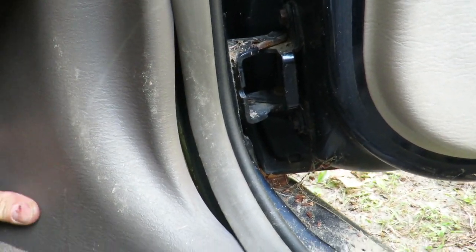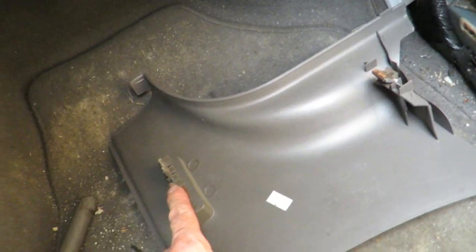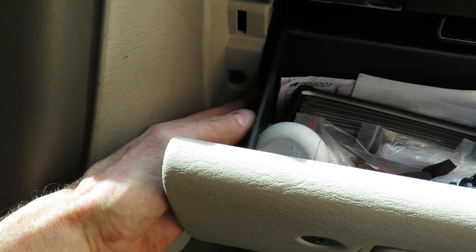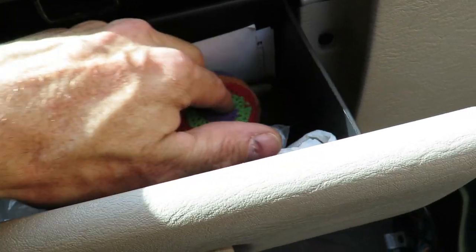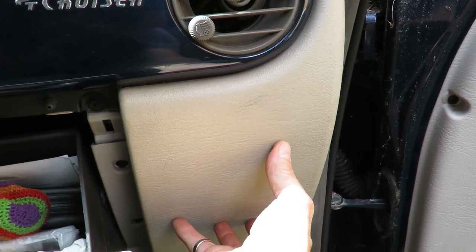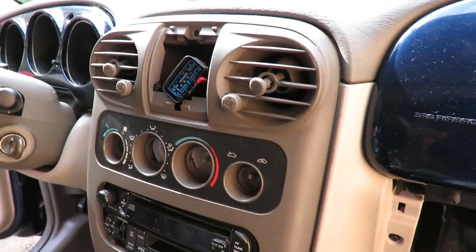They kind of twist a little bit at the top. There are just a couple little clippy things. Pull straight out — same thing on the other side, right where your hood latch is. Then we're going to take out the glove box and just tip it down. There are two little push-button stoppers that you slide in, pull those out. Then take two screws out and this side cover comes off. Do that on both sides.